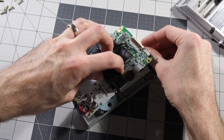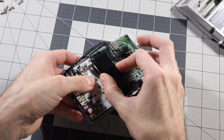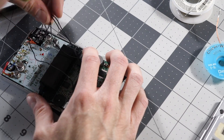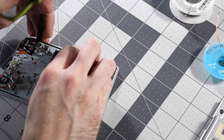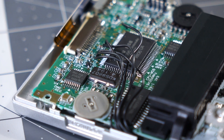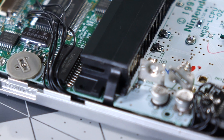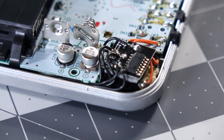You'll want to leave the wires a bit long. After you get them all soldered, drop the logic board back in the front housing so the wires can be routed properly. They need to get tucked in between the board and the housing like this. I used a spudger to help get them into place. We need to run the wires this way so the case will close properly, since there's not much free space inside. If you do it right, you'll end up with an organized bundle of wires, and you can still remove the board later for cleaning the case without having to desolder any of them.